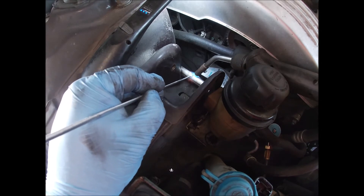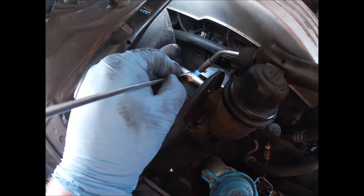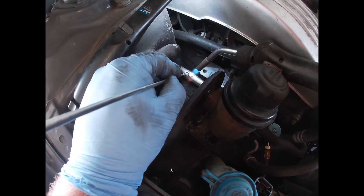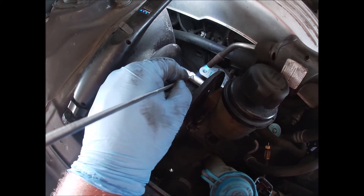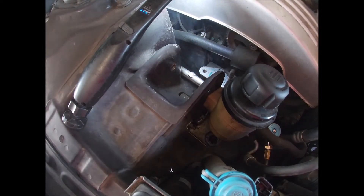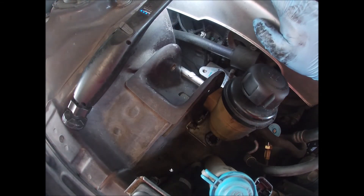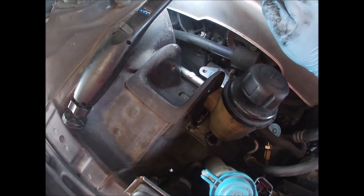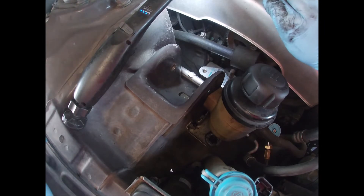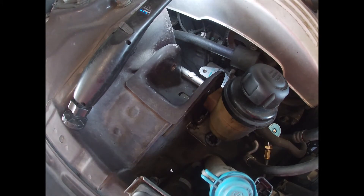This is what you want right here — take the heat away a little bit. I'm just going to fill that whole area in — one big old bubble. Now it looks bulky, I probably did a little too much on it, but the objective here is to repair the line. If using more brazing rod than you have to is what it takes, then just do it. All you're doing is patching this hole up — that'll take a minute to cure.